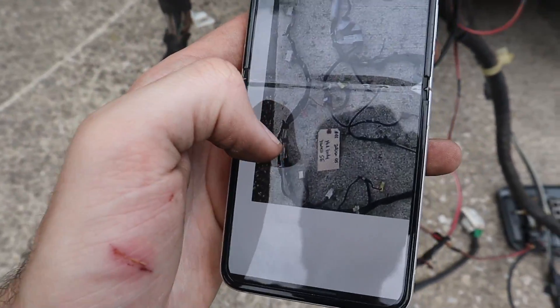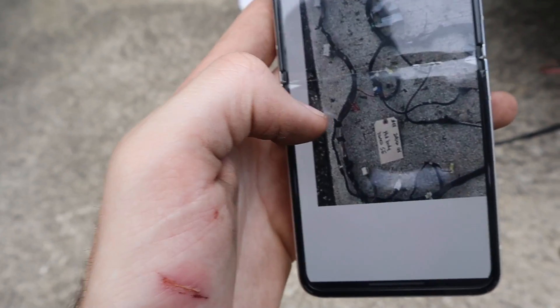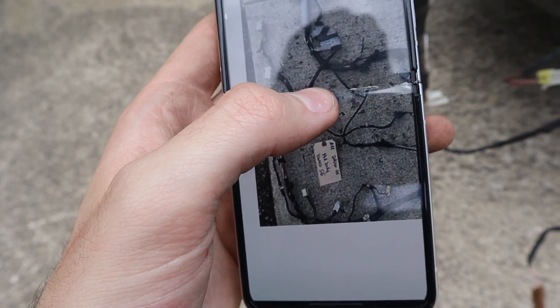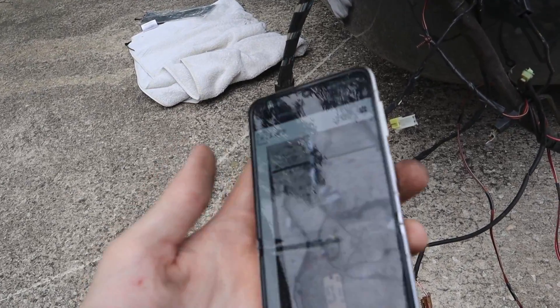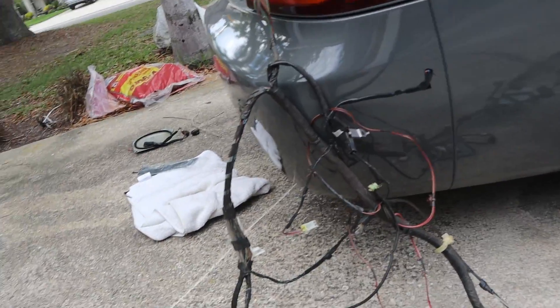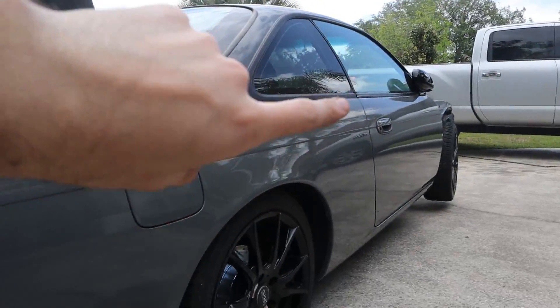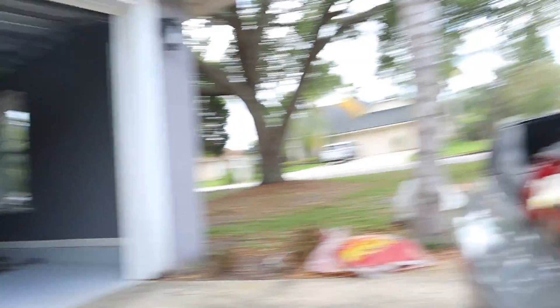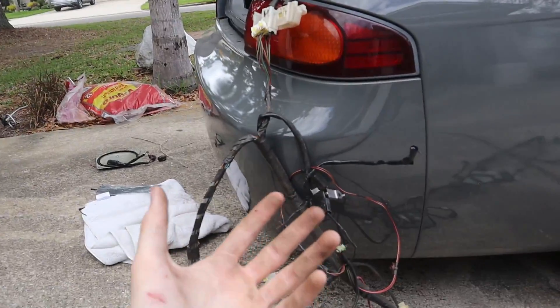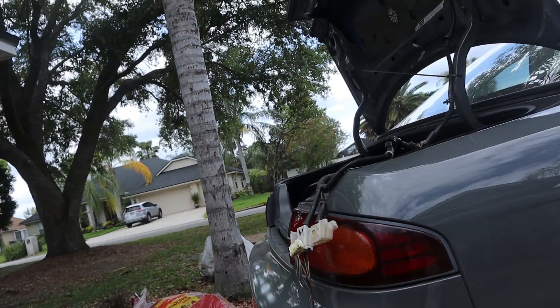As you can see there are two plugs right there, and then the wire runs from here down — which mine does not do — and we have three plugs stemming from it. So I am missing three important plugs. I'm going to go ahead and order this body harness. As I'm doing this I'm making a list of things I'm going to need to order — like a new light bulb, battery terminal pieces, a new mid-body harness, and a few little blinker pieces. That's why I don't have a lot of these things — if I don't start tearing into these wires today, I won't know what I have and don't have.